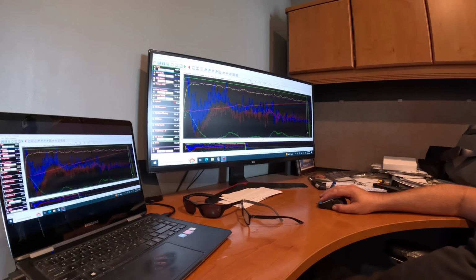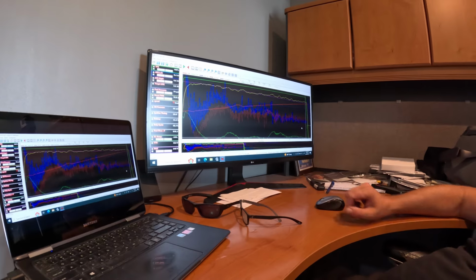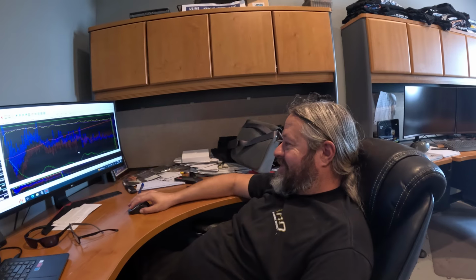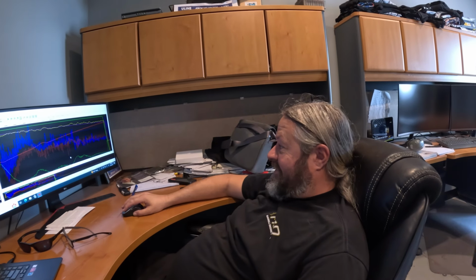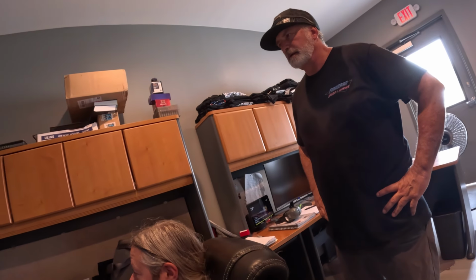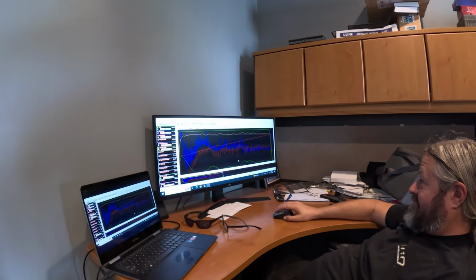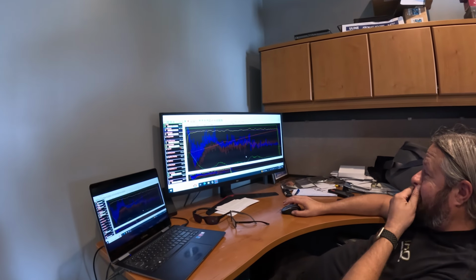The bigger thing is that we retuned it, but we didn't actually send it in to the computer. Maybe that's the world telling us we didn't need to run that test. It helps if you actually send it in. Forgot to send the file to the ECU. But it is hotter. It got all the way to 265 air inlet temp on the blower, another 20 degrees hotter. It spun on the dyno again too.